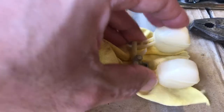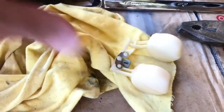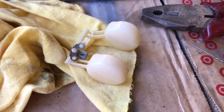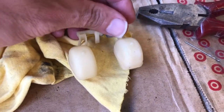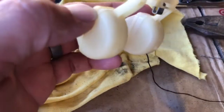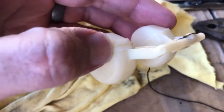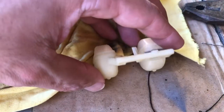Then turning the float over onto an absorbent rag for all the fuel to wick out through the rag. Another method is also, if there is any remaining fluid or fuel left in there, to get a piece of cotton and to stick it in to the fuel float with a needle and to leave it for a few minutes, and the cotton will wick the rest of the fuel out.